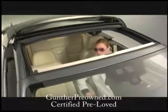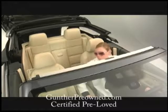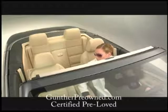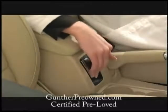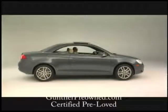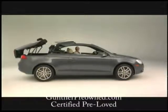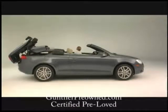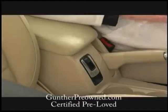If you have an EOS, there are things you should know, like how to open the electric convertible hardtop. You do a few things and you listen for a few sounds, but there is a specific way to operate it that must be followed — always. Park the vehicle on level ground. Engage the parking brake. Secure the luggage compartment and make sure no objects are improperly stored. With the engine on, press and hold the control button in the center console to open the roof. Listen for the chime — that is the signal to release the control button.